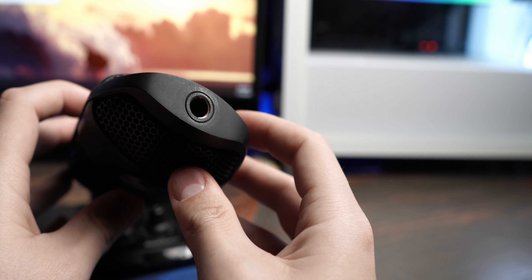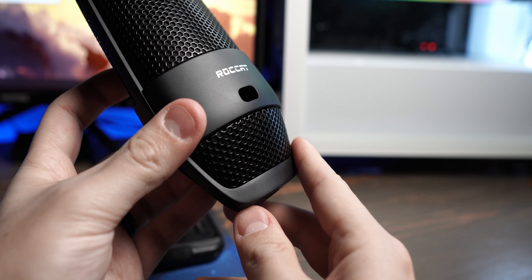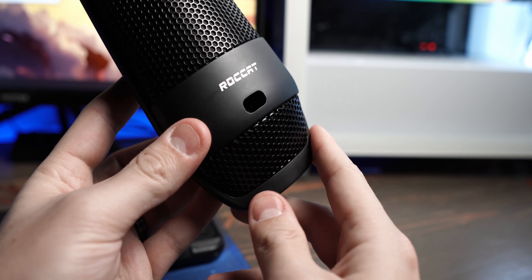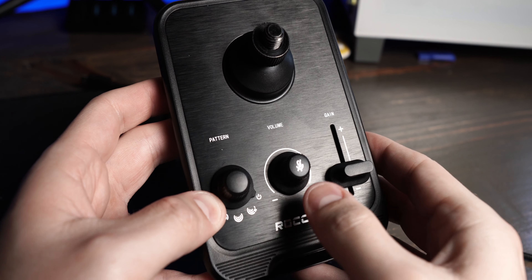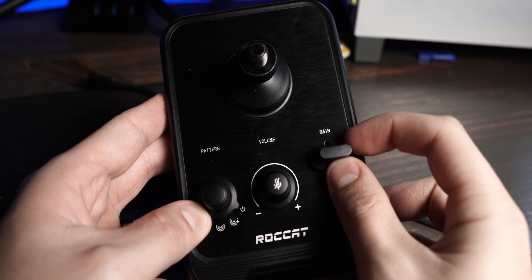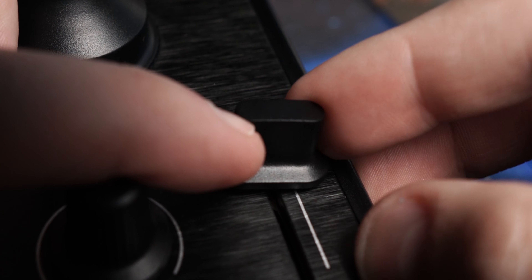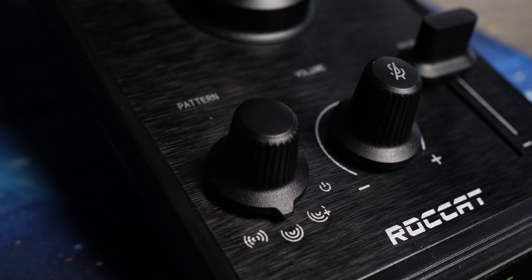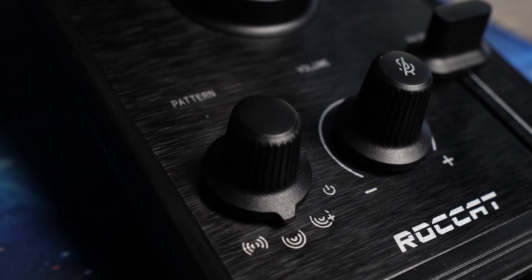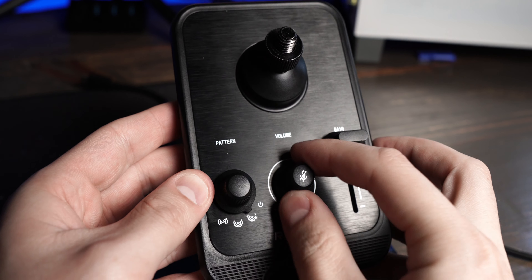Now we are unmuted. On the actual microphone you have a 3/8-inch thread on the bottom as well as a proprietary USB-C port on the back to power it. As for the base, unfortunately the build quality here is kind of a miss for me. For starters it's mostly made of plastic, and while that alone doesn't warrant concern, the feel of the slider that controls the gain definitely does — it's loose, it's weak, and sliding it feels absolutely awful. I don't mind having a slider for the gain, I just wish it was more robust and maybe had a locking feature. The easier path for Roccat probably would have been to use a knob, like they did for the pickup pattern and volume controls, since those feel great.